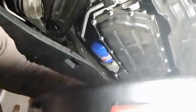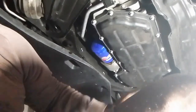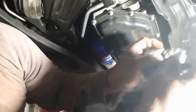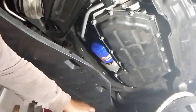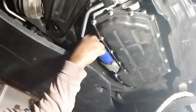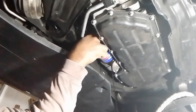Ready to get it done. I already got my catch pan for the oil filter. I got my oil draining out of the oil pan — I took the plug out already. The plug takes a 16mm socket. I always use two catch pans: one for the oil, one for the oil filter. This Jaguar XF — oil is a nasty deal here. You've got oil coming from two places, so you need two different catch pans.